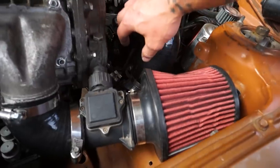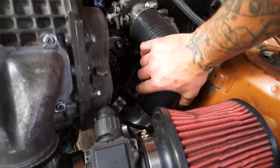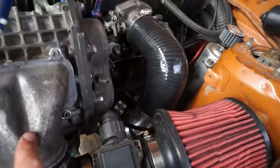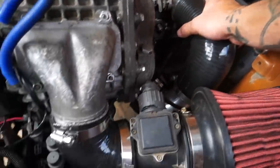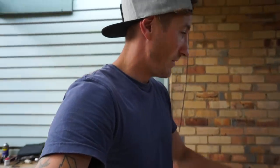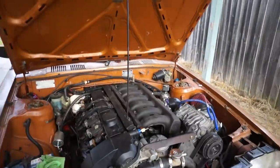So the valve goes on the charge pipe, and as soon as you let off the throttle, it releases that pressure back into the intake. Thus, no more popping intercooler pipes. So I have to order one of those off eBay. They're about 30 bucks. I'll do that right now before we hit the dyno. But I did feel the boost, and the car runs perfectly now that we've put the new tank in as well. So everything's great. I just need to put the M52B28 injectors in, the pink ones, just to give us a little bit more fuel, pressure regulator in, tidy things up a little bit. And then it's going to be ready for the dyno, and then the track, which is awesome.